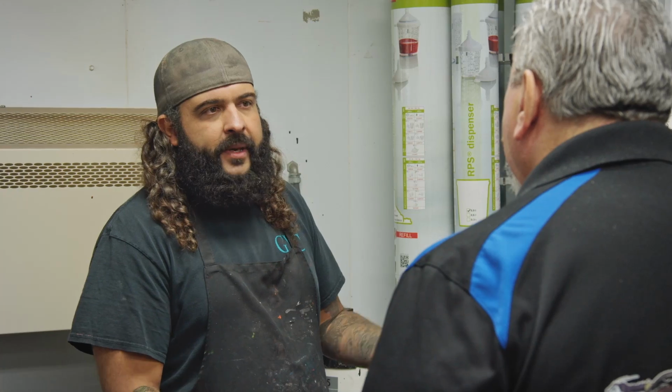Now, I did notice some sand scratches though. All that'll be gone. That's just for pre-paint. We finish it off in 220, and nobody paints over 220, but because it's a pre-paint, it's okay. So it'll shrink back into it, and then we'll block it out with 320.